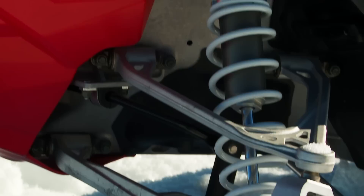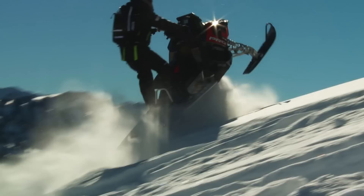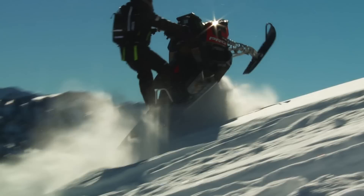Getting to 408 pounds took a lot of new technology and some serious forward thinking, and can only be described as a mountain sled like no other. From the beautiful forged aluminum upper and lower A-arms that save 1.5 pounds, to the Walker monotube featherweight shocks, quick drive low-inertia belt drive, and an all-new Polaris Exclusive Series 2.6 lightweight track — the RMK is a feather.